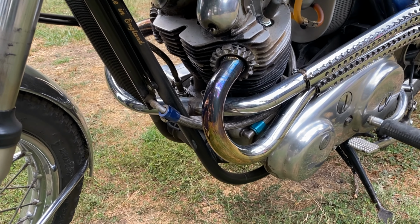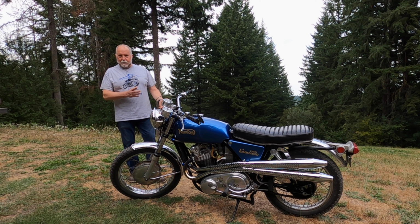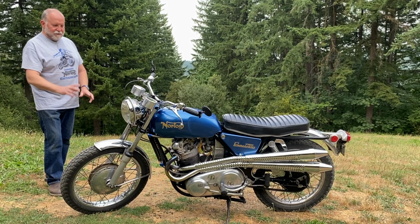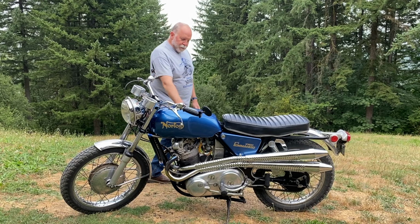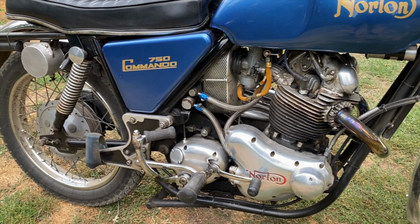And you put an oil cooler on it as well, I see, Mike. I did, yeah. I went to Portland Transmission and said, I need an oil cooler about this size. Took a piece of cardboard down there, after I kind of cut it to put it in above the pipes and everything, and set it up and did the braided line and ran it through, and then there's a vent line that comes around and up to the top, and I put an oil catch can in it.